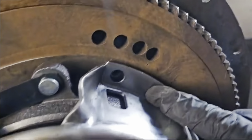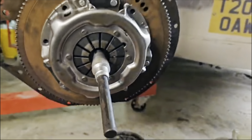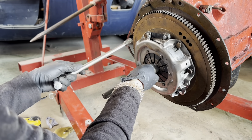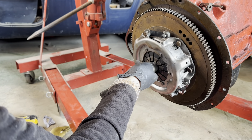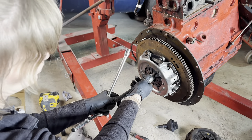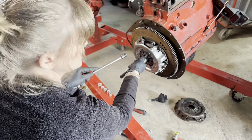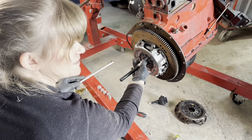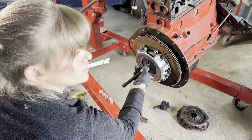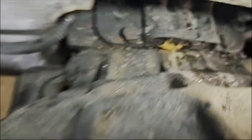She's sitting there now. We align the pins and pop them on — you might need a little hammer. Go from the bottom first because the pins can be tricky. Once that's on, we need to bolt her up. I've put the bolts in roughly by hand. Don't use the gun at this point — you need to hold the support tool nice and straight, because as you do these up the pressure plate is what holds the clutch in. Really important you keep it straight. Take your time, one by one, tighter and tighter until they're all nice and tight.